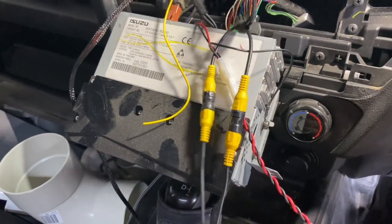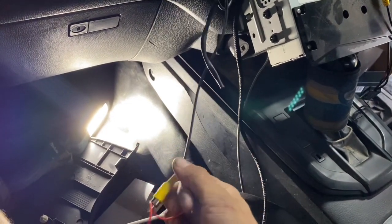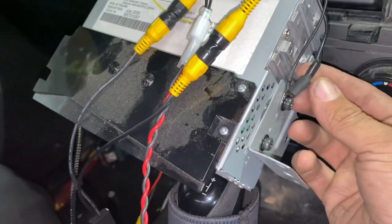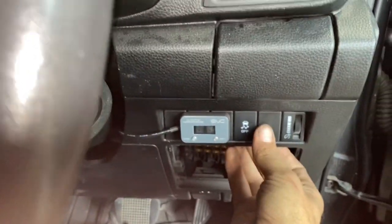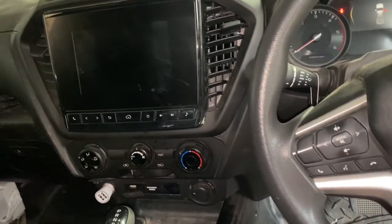If you're doing the front camera option, you've got to run a twin cable and that aux cable that comes with your camera - that's just a little shield there. The way I run it is just down through the dash and up and in through the firewall - you can see it on the other side, it's pretty easy. Once you've got your active and neutral done, all you're going to do is get the loom for your switch, route it back through under the steering wheel, pop out one of these, and put your new camera button in. After you've put that button back in and put your dash back together just like that, you are good to go.